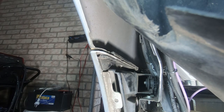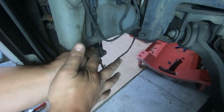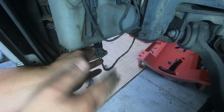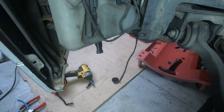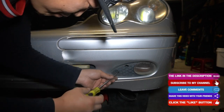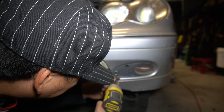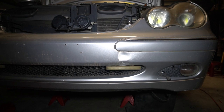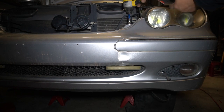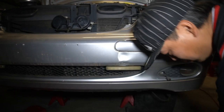Now, we'll go to the front of the car and remove the last bolts and screws so that we can begin to pull off the front bar. While we're here, we may as well disconnect the fog light as it is connected to the front bar as well. I've already changed mine to HIDs but the principle is the same — you just have to press on the tab here and then pull it out, and that is your fog light harness removed. One of the last things we need to remove is an 8mm screw that's inside here, and last but not least, another 8mm screw that holds the front bar at the top here.